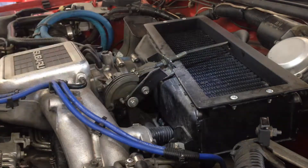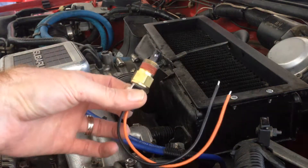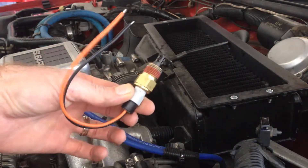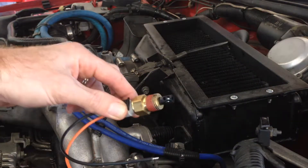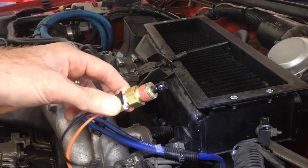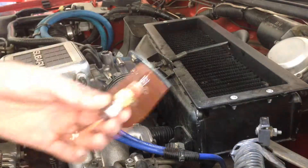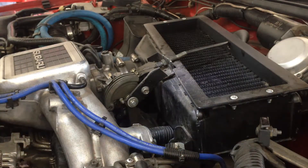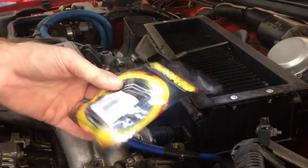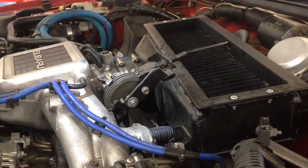It's time to sort out where to put the intake air temperature sensor. I've got the open element version, which is recommended for turbo applications because it can recognize fast temperature changes. It's just a GM type two-wire sensor. I've also got the aluminium 3/8 NPT bung, or threaded boss.